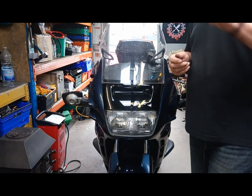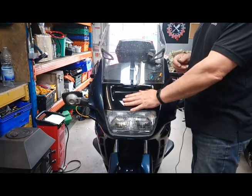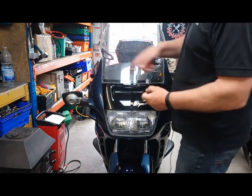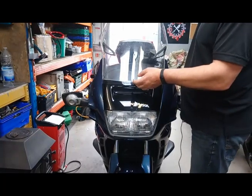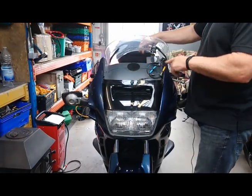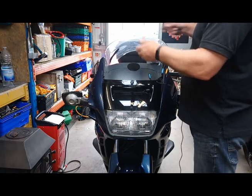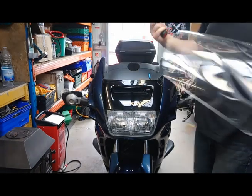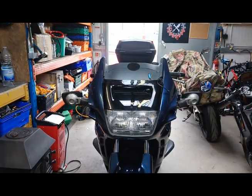While the mirrors are warming up to soften the lenses, we have to take the screen off and this middle pan because we need to get in. The screen's held on by five screws — simple screws like this — so pop those in your pot and keep them safe. Then we can lift the screen off, being careful not to crack it. You'll notice I've got some wires here; those are for the dash cam which records the front and rear of the bike as I'm travelling along. So we've put the screen safe out of the way.